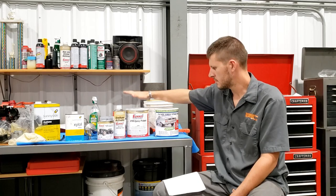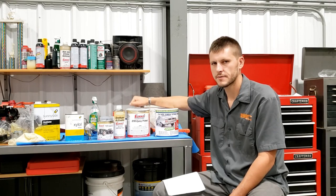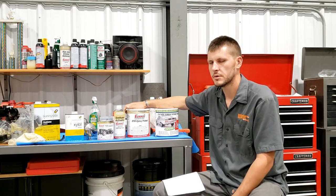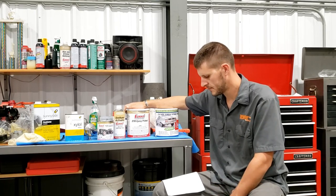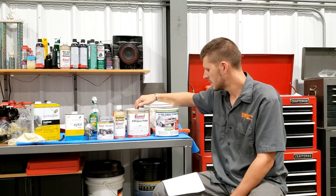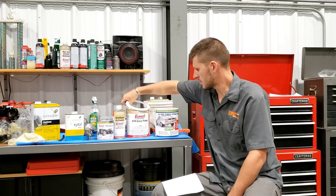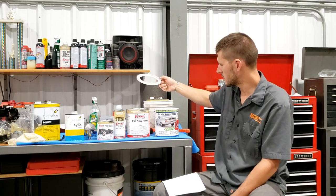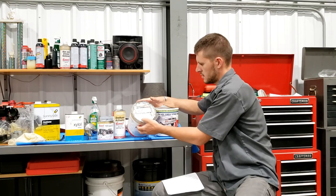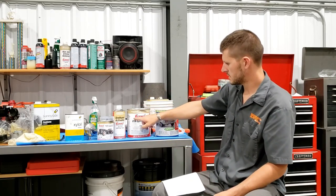So when it came time to spray everything, it took about 2.5 hours for the first coat of the POR-15 to get tacky. Sprayed the next coat. That one only took about 1.5 hours. It was a lot thinner coat. And then came time to do the epoxy primer. And so I have this DTM epoxy primer from Summit Racing. And I've stored it according to their conditions in a climate controlled room in the dark. And I put it on the shaker and there's all this like beeswax looking stuff coming out of it. And the top popped off and it was down to about this level.